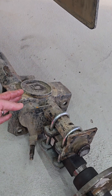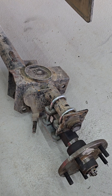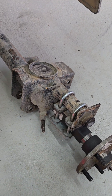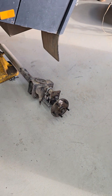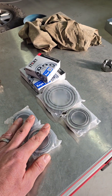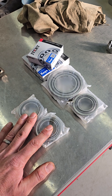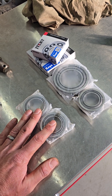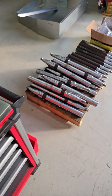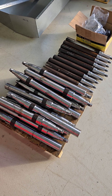Hopefully those owners of 170 or 190 offset parallel vans are aware of it. There are a couple of ways to manage it — you're welcome to contact us if you'd like that information — but the reality is you are relatively high risk, so it's a good idea to consider upgrading, maybe just at the next service. The bearing sizes are a worthy upgrade alone. To avoid the potential of stub axle failure is probably reason enough. When you combine it all together, it's not bad value. Atlas is giving you two good upgrade pathways: either go to the chromoly axles, or go to the complete suspension system. Alternatively, reach out to Track — Track can build your arms as well.